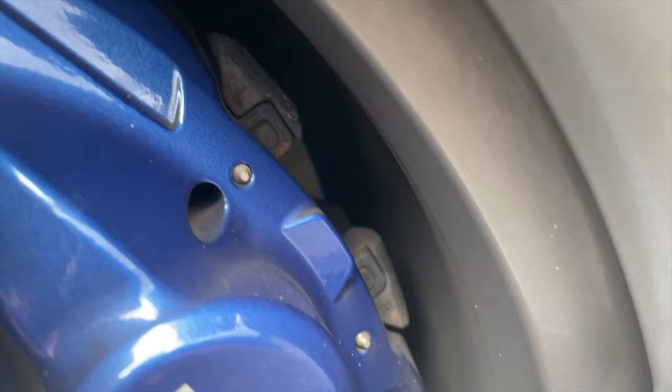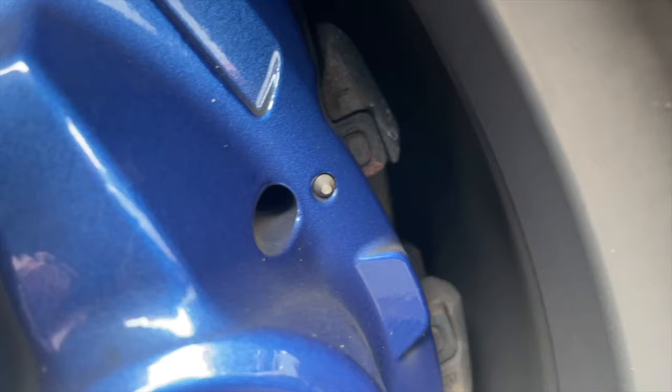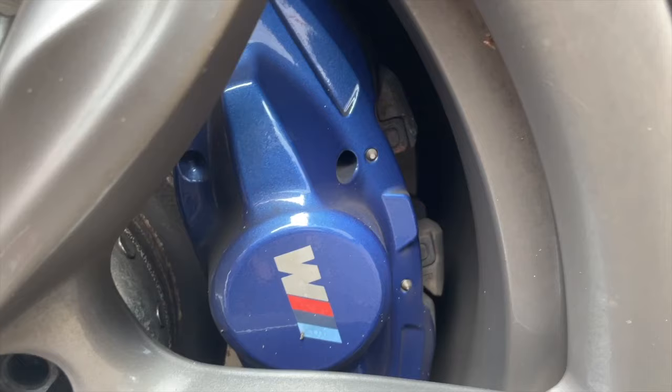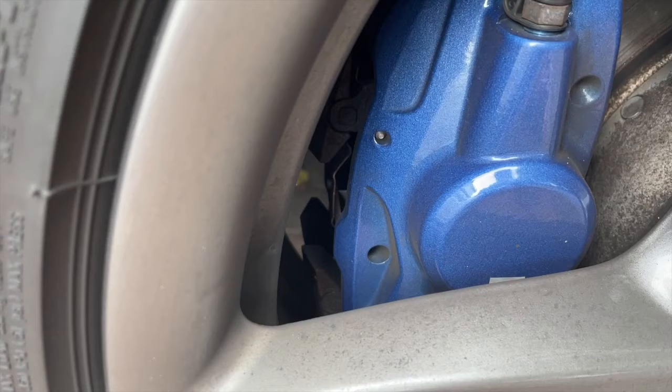Really good, especially if you're going to a track day or something like that, is being able to change your brake pads really quickly. So if you look down here - there's two pins that you can actually take out and they go through the brake pad there, and then you can just slide them out the back of the caliper. It's really quick, really easy - it just means you can change your brake pads over quickly. I think it's only on the M Sport Performance brakes that you can do that on. I'll show you the front one as well - a bit easier to show you on this one. See how there's a hole in the back there? Just slide them straight out of there.